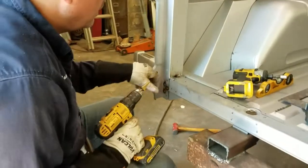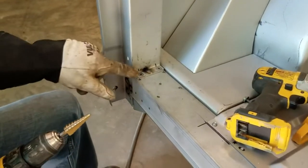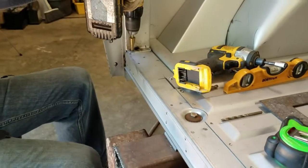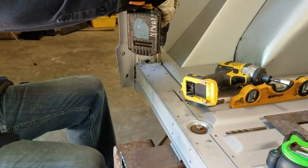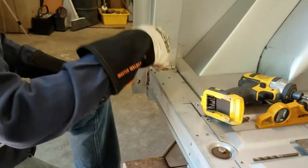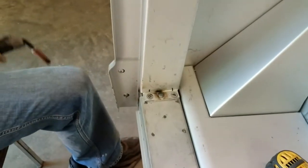All I should have to do is just go down about an eighth of an inch or so and the bit should just pop through because it's drilled from the backside. Now I have a nice stepped hole and I can really penetrate down in there and get some good weld on it.